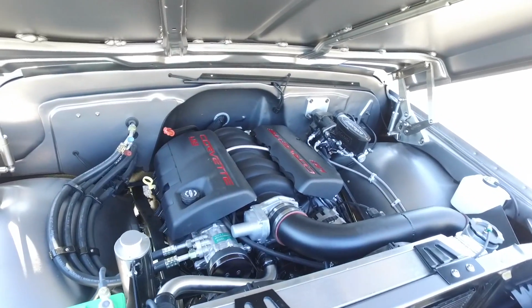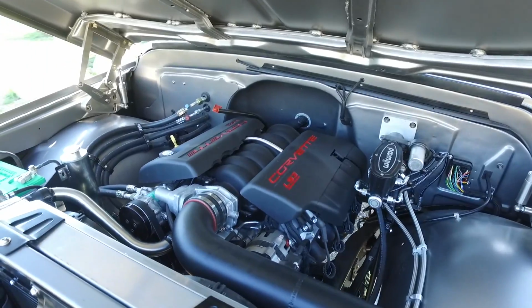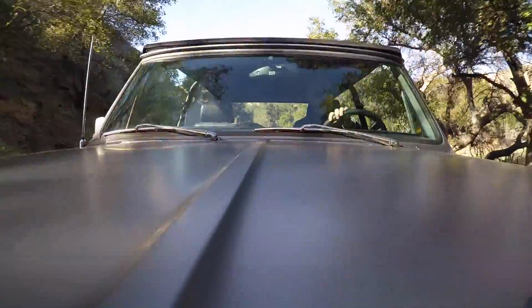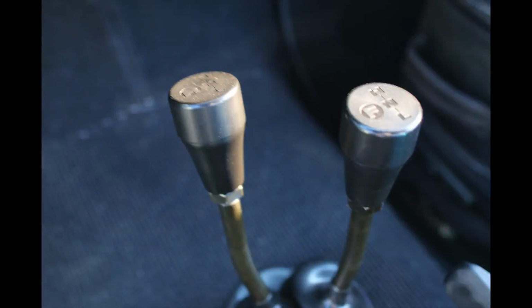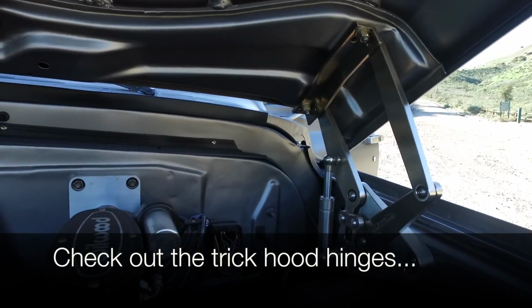So mechanically, this truck is just tons of fun. We are running a 6.2 General Motors LS3. It's putting down about probably 330, 340 horse in its configuration as we have it. And then we're sending the power from there through the 3/4 ton General Motors 4L80 transmission, which in turn sends power to our beloved Atlas 2 twin stick shift on the fly part-time 4-wheel drive transfer case.